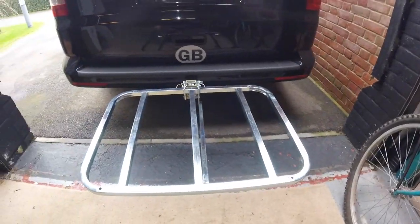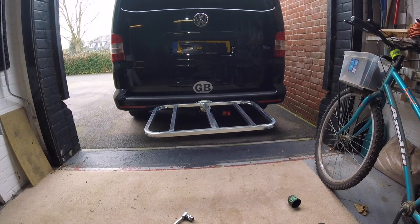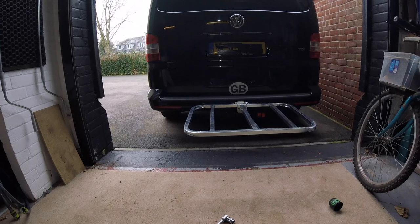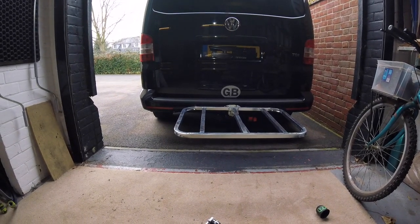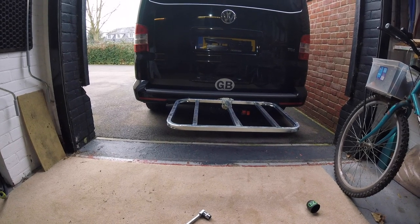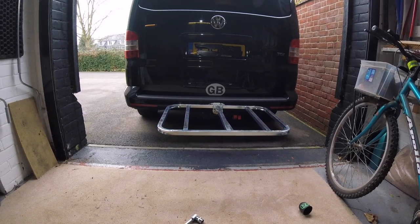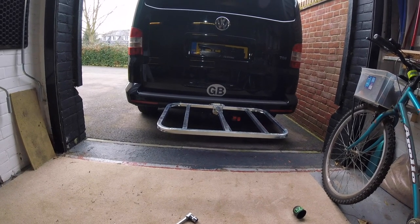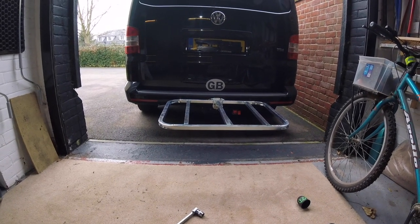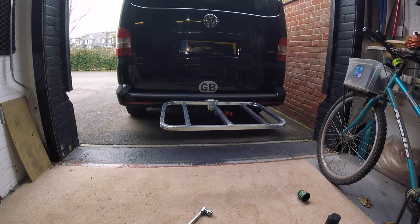The main cosmetic difference between the Backrack G3 and the Thule 949 is that this rack does not have a built-in light bar. It is my intention to use the Thule backup box on this rack, which is about 420 litres — it's not primarily designed for this rack and I intend to make up some fittings to allow that installation. The rack itself can be used for a number of different things and they make a number of different options, including small baskets and headboards. With a payload of 100 kilos, you'd obviously have to check your nose weight of the tow bar on your car, because not all vehicles would naturally be able to take a 100 kilo load.